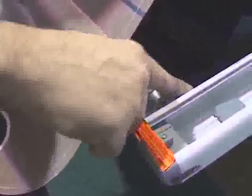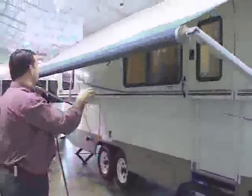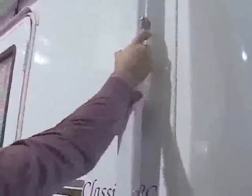Remember, keep a hold of the awning when you do this so it doesn't take off on you. Locate your lanyard and use that to raise the awning more slowly. Then come around to each arm again, lock the outer arm in position, and tighten the lock nut on the inner arm so it doesn't vibrate loose while you're traveling.